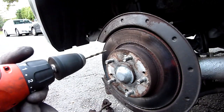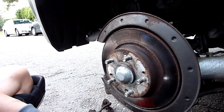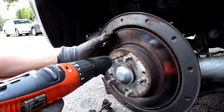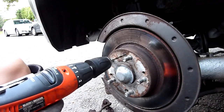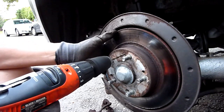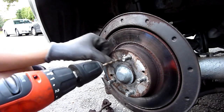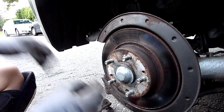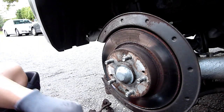I'll cut the threads instead. Slow speed again. The drill's running out of juice — I could do with using my other drill, but I'll use it until it runs out. So this is 5mm now. I'm not going to go too deep — 5mm will do. Let me do it at 5mm. Swap to a 4.5mm — no, the 4.5mm is broken, broke off on another job.